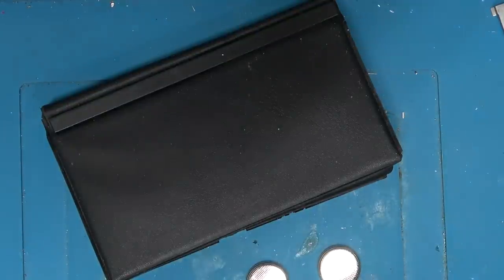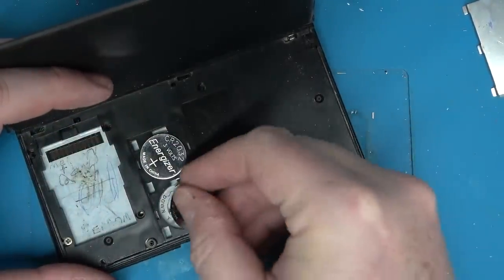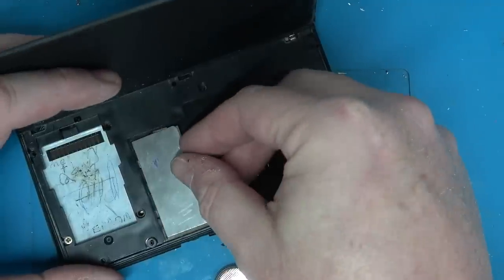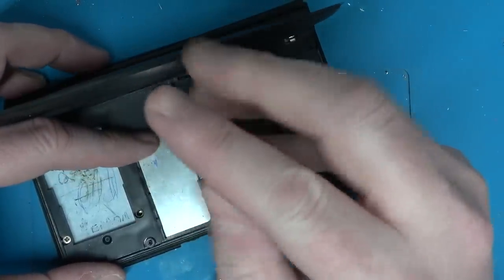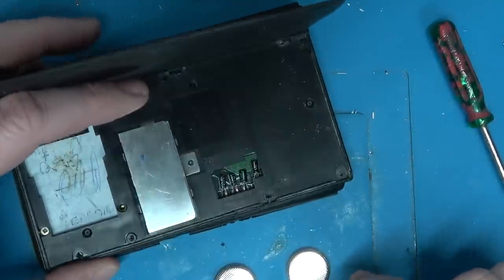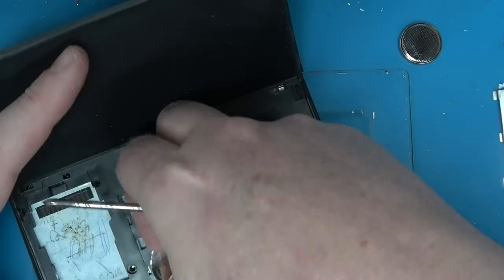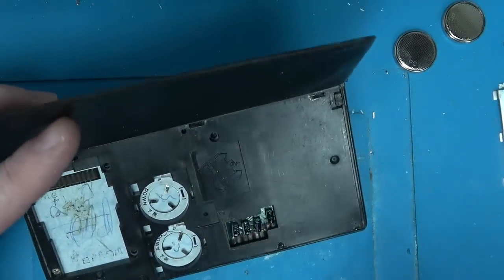Three, maybe a little bit on the low side. Let's make sure it's not the batteries first. I was originally going to work on programming for the MGC thing today, although I did a lot of that on Thursday and Friday. I did find a good PCM audio example, which seems to work. You can basically DMA 8-bit samples into a PWM counter.